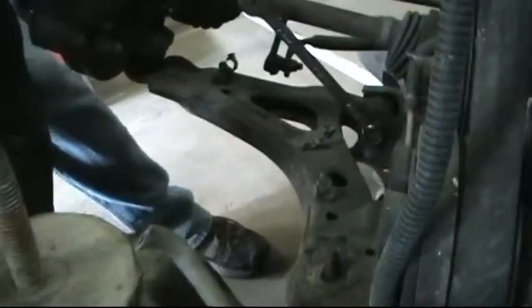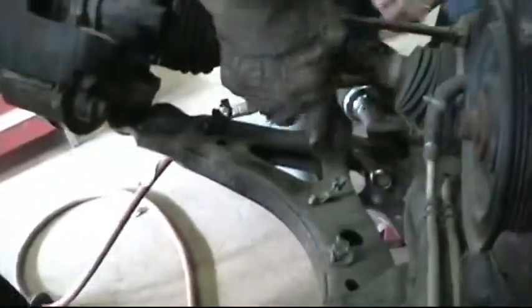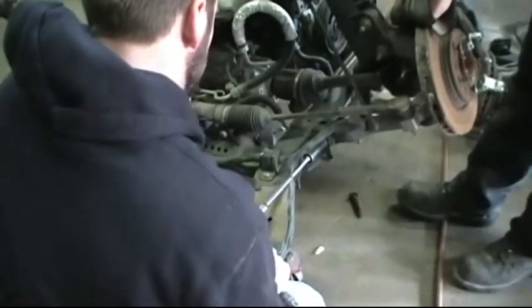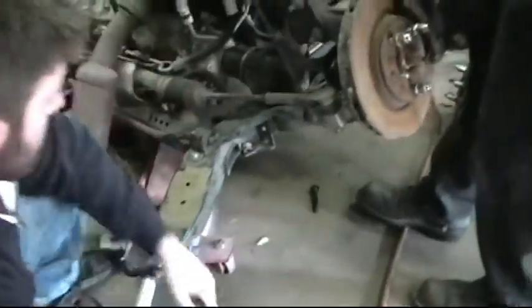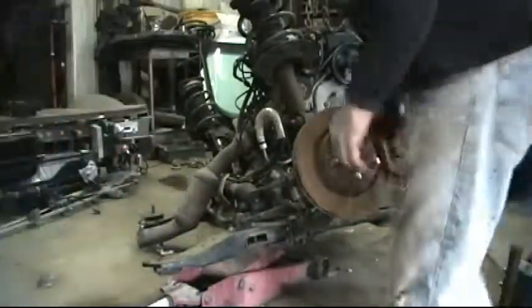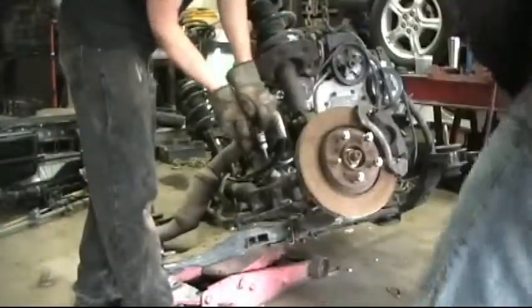I'm going to tap that — there's a hammer right behind you. And this one right there. Let's use that one. And then also we're going to need to take... this is a torsion bar link. We need to unhook that. Let's unhook the torsion bar link right here. Take a look at what you need there. I'm going to need an extension. Now before we take both of those off, let's unhook this — we'll need to probably oil that a little bit, but there's an Allen cut in there. It's probably about a 15. There you go. Fight through that all the way out.